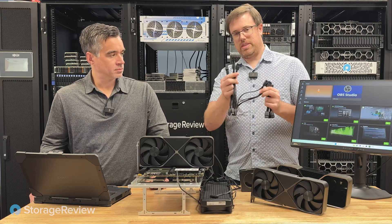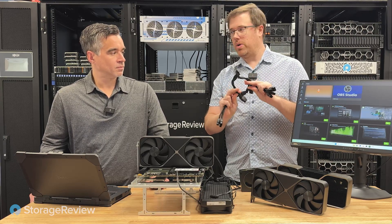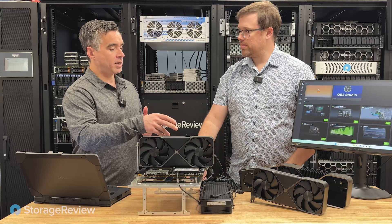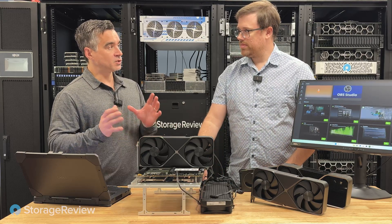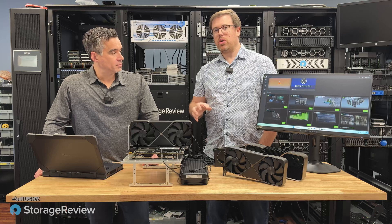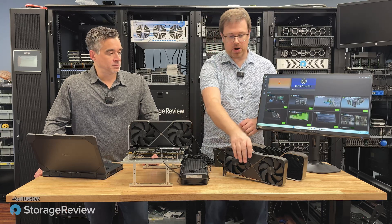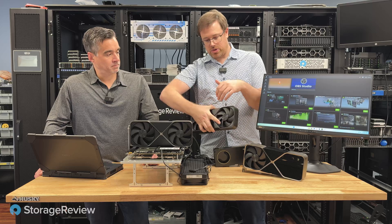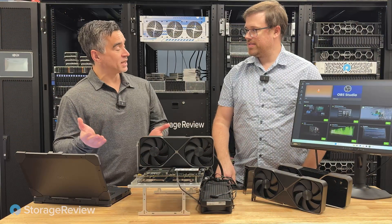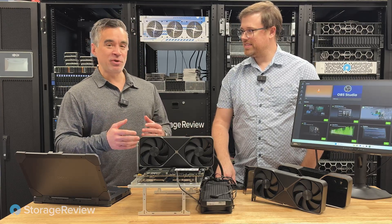On workstations, they might be set up for two graphics cards — you steal two eight-pin connections combined into a single 600-watt 16-pin, and you're ready to go electrically. But the problem with most workstations is they're not rigged for high-airflow GPUs like this. We noticed in a couple where it's a little snug — the GPU will fit, but the airflow is not ideal. Cooling plays an important role in chassis design. A big part of how this card was redesigned on cooling is drawing cold air from the front and blowing hot air back — nothing comes out from the edge of the graphics card anymore.